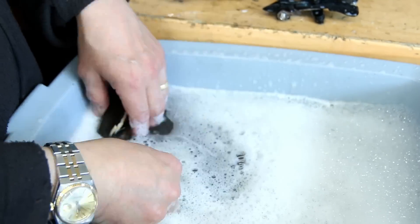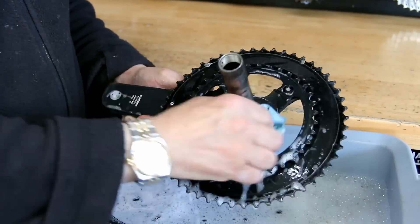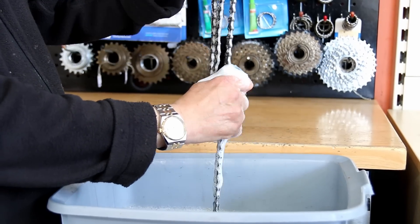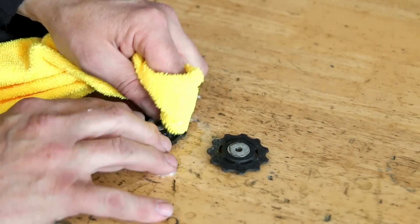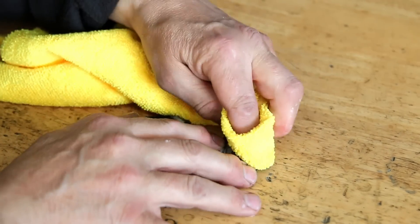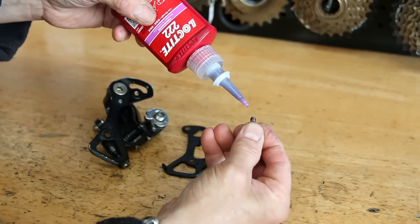At the ultrasonic stage most of the dirt is already off, so you're literally just rinsing off the degreaser. The chainset itself we just wash down as well — we didn't put that through the ultrasonic cleaner. The chain had very little stretch in it so we just dry and clean that off. Next we clean the jockey wheels — these have bearings so they don't go through the ultrasonic cleaner; we use wax polish on these to remove residue from the last chain waxing. Now the entire drivetrain is completely ready for the re-wax chain.